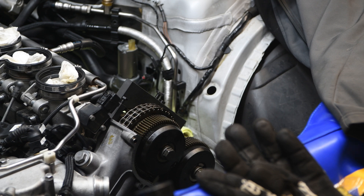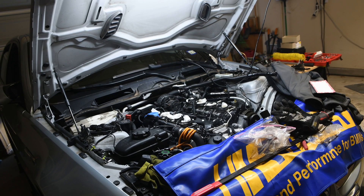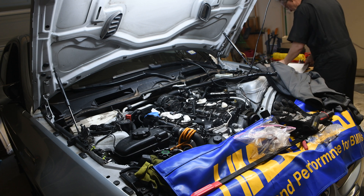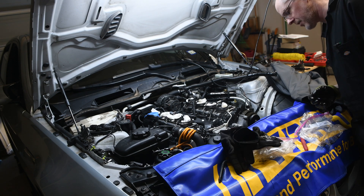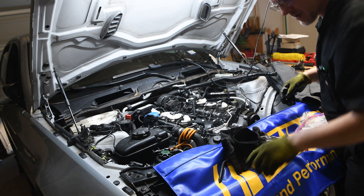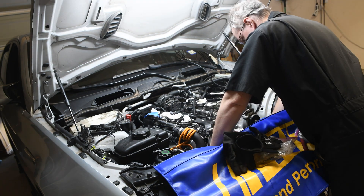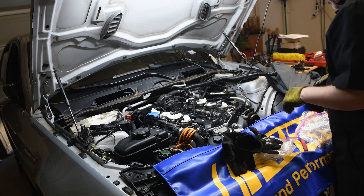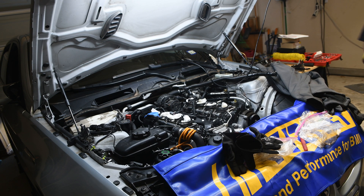I'm going to re-read some instructions. Glad I did — having done the calibration and the stretching once, not at top dead center, you now stretch it at top dead center. Back to 10. First I need to rotate with tools in hand. Top dead center achieved. Now we re-torque it again. It's not easy to do.